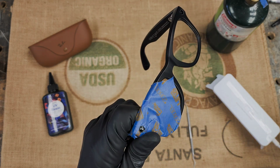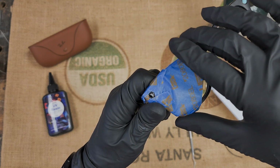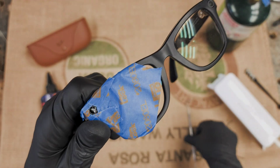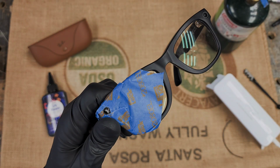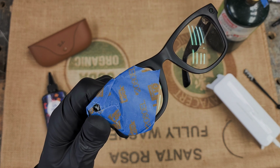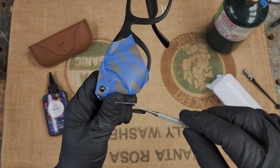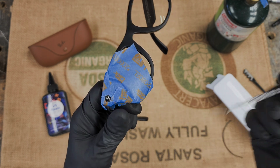That one was actually super quick. So I just run it over a little bit and just keep pressing it, and you see it is broken, the glass. So this step here is one of the more important steps. It'll kind of determine how well the final product will be. So still use the same dental pick, and you're going to want to clean out all the glass. Make sure you get every single piece.